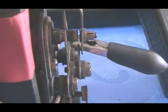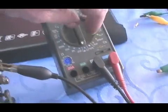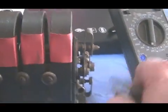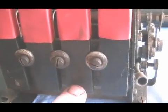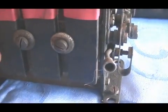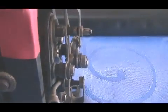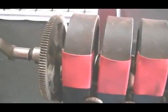You can see the gap there really well — that's the coil open and that's the coil shorted. The voltage spikes come off when the coil opens. Even though these magnets are very weak — they're barely able to lift up a 3-inch nail — when your coil is shorted inside a weak magnetic field, it starts to build up a very strong magnetic field. When the coil opens, that magnetic field collapses and we get our high voltage surge.